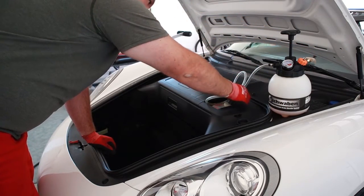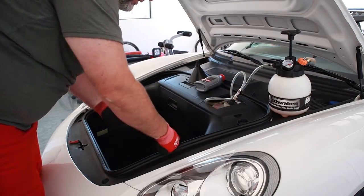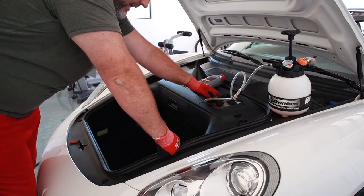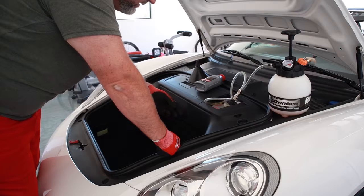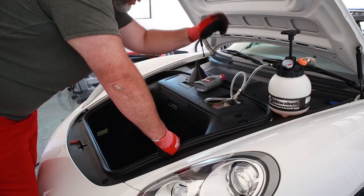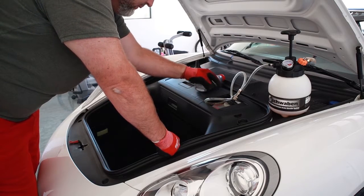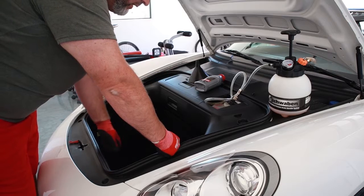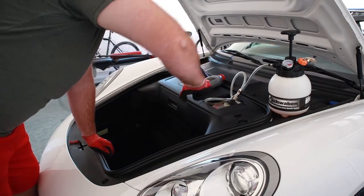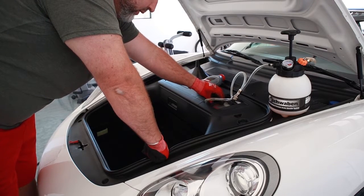So you fill this through here, secure that tightly, depressurize the system, lock this unit on here very firmly, and again I would introduce another blue cloth there just in case you didn't quite get it as tight. You thought you did it tight enough, but it turned out you didn't. And keep an eye on it as you're introducing the pressure. So the first time you're putting the pressure in there, make sure you're watching closely for any leaks. I didn't have a flood by any means, but it was coming out at a pace that clearly I didn't crank it down tight enough. And again, this is loose in here, so you feel like you're really cranking on it.